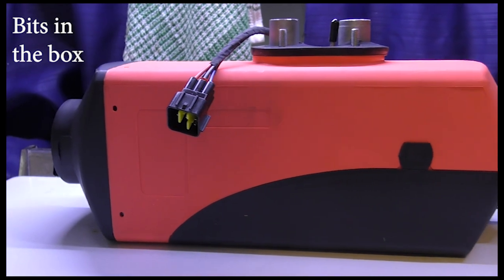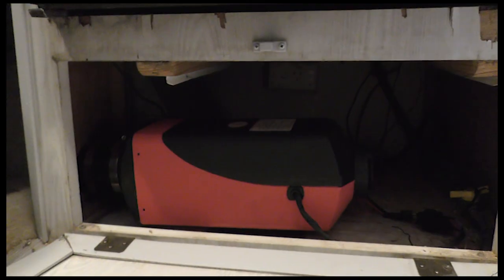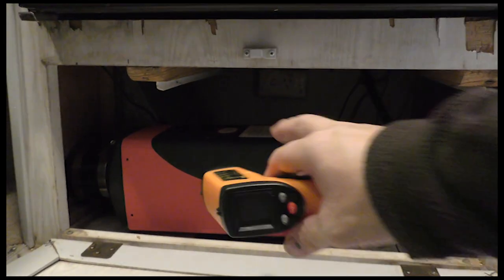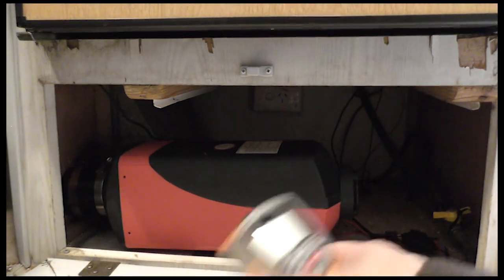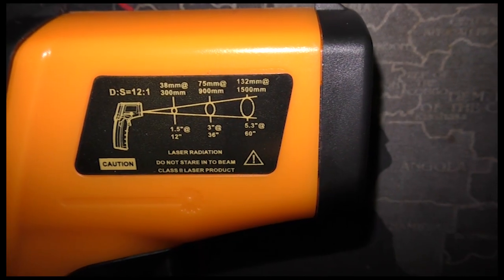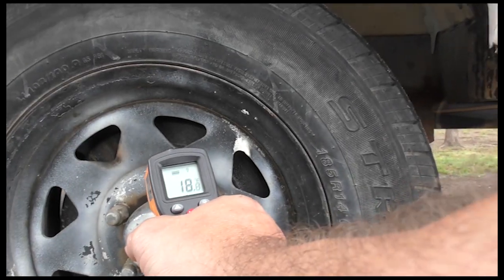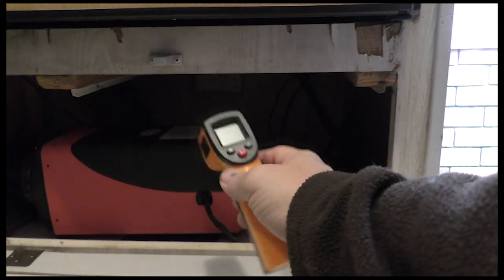My recommendation for the 3 kilowatt one in a 17-foot van is just have it on its lowest setting or near enough to its lowest setting. You're only using about half an amp, and in a closed caravan it'll heat up pretty quickly. Now as far as concerns for temps being under the fridge itself — obviously I have those. So we're going to get a little thermometer. I've done a review on this little guy — link in the description and there'll also be a link where I picked this up off eBay. These are really handy, around about 10 to 12 bucks.